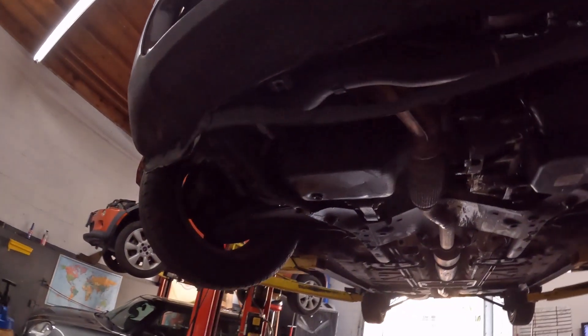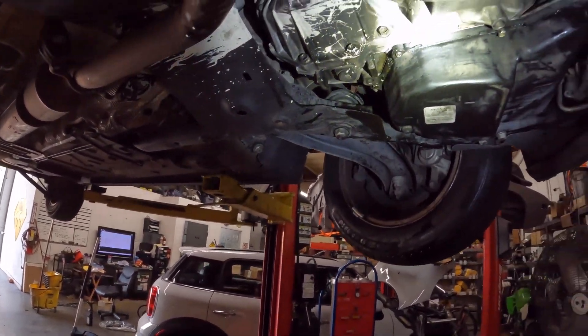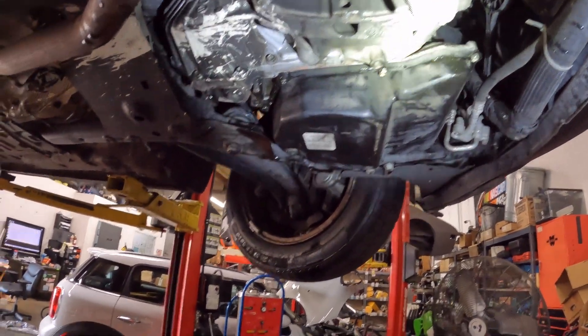It does look like I got some transmission fluid on me — I was pumping up the fluid into it and the thing slipped off and got me. I knew I was going to take a transmission shower and I did. I got it all buttoned up, all tightened up, cleaned up around the gasket so I can see if it's leaking after a test drive. I'm going to clean up the floor, put those three 13s back in the mount on top, hook it up to the scanner, reset the transmission adaptations, reset the engine adaptations, then go drive this thing. Pretty good day here — thanks for watching guys, we'll see you in the next one.